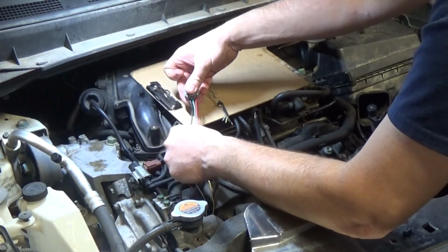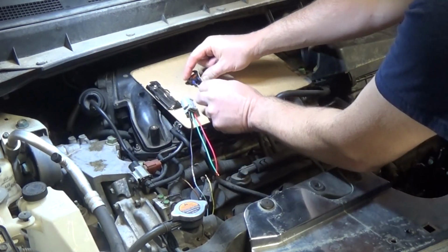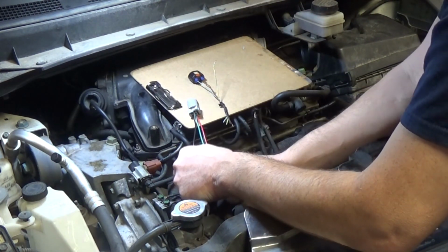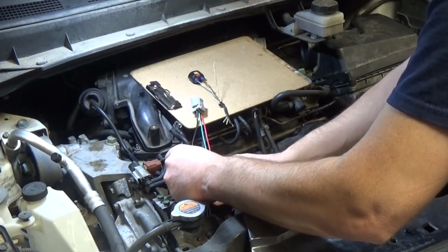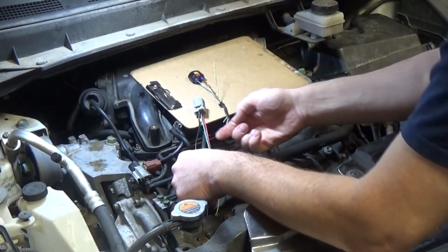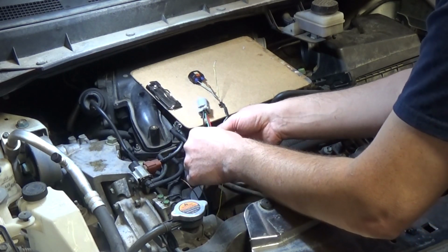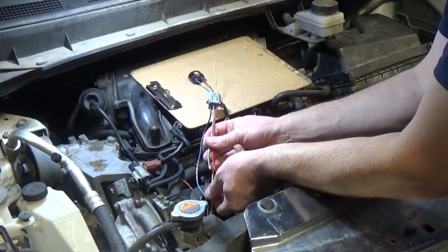the second one. So again, I'm going to connect my middle wire, which is one that's actually broken, this yellow and black. So here's the yellow and black. I'm going to slide my shrink tube all the way down. I don't want to expose that to heat because it's going to shrink on me. And then I'm going to get my other tube here. Now what I do, I just put them together.